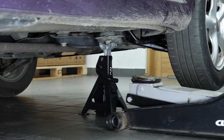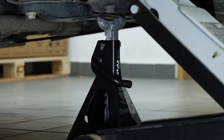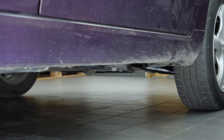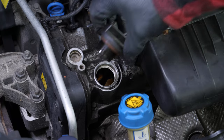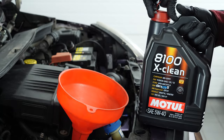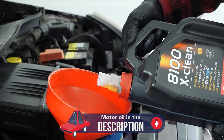It is necessary at this point to pour oil back into the motor. This step must be done with care and precision. Put the crankcase back in place first, then lower your car to the ground and check the oil level — this can only be done when the vehicle is flat. Begin by putting 90% of the suggested amount; this will leave you a large enough margin to adjust the level appropriately. You can find in the tutorial's description the exact quantity of oil recommended for your car.